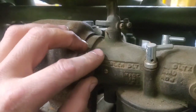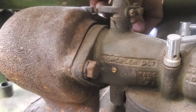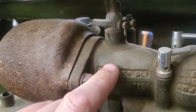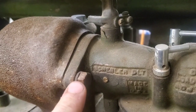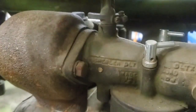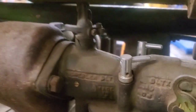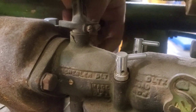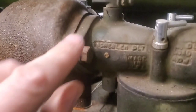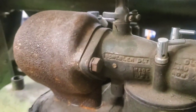As I go along I'll try to give tips to make things easier. The bolt on the back side here is a little hard to get to, so I always loosen that one first. Leave this front one tight, because if you take this one out first and then loosen the back one, the whole thing wants to move and you can't get it out. Get the back bolt loosened while this one's still tight, then spin this one out with your fingers - it's just a little trick.